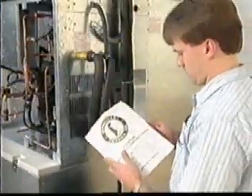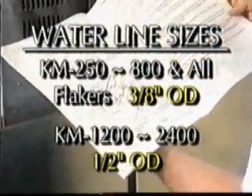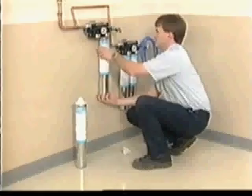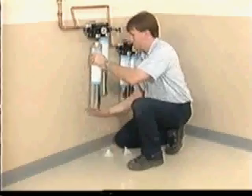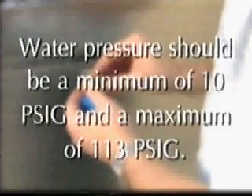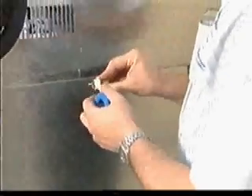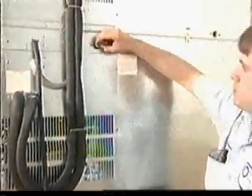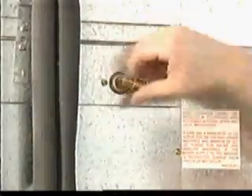The ice maker inlet water line must be sized correctly for proper operation. Check your manual carefully to be sure which size is required for the ice maker you are installing. Depending upon the local water quality, the installation of an external filter with an adequate flow rate may be required for the ice-making inlet. The water supply pressure should be a minimum of 10 psig and a maximum of 113 psig. If the pressure exceeds 113 psig, you will need to install a pressure-reducing valve. On water-cooled models, two separate water supply inlets are provided — one for the ice-making inlet and the other for the water-cooled condenser inlet.